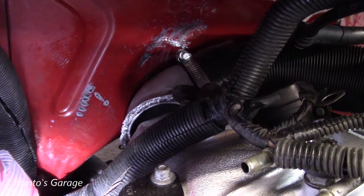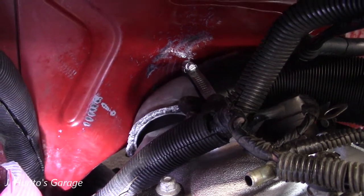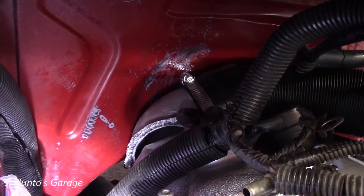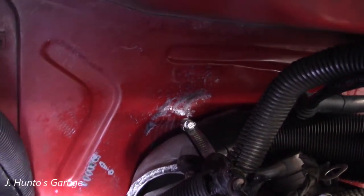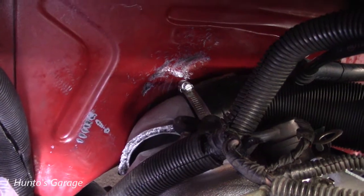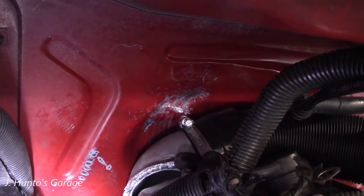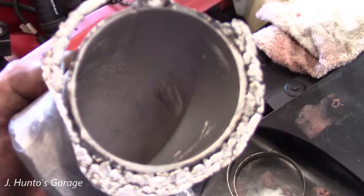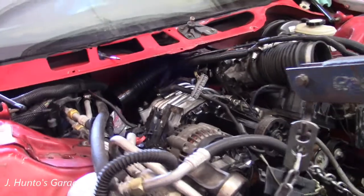I worked on the firewall a little bit, but in lowering the car down, the 90-degree elbow on the back of the supercharger broke off — there's just no room back there whatsoever. You can see at the bottom middle of the screen the broken intake elbow along with the tube. It turns out there's essentially no room between the supercharger and the firewall — even the small EGR valve tube is really sandwiched in there. Stay tuned for more to see how we're going to fix this. Thanks for watching.